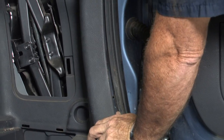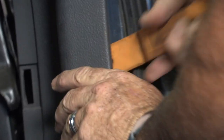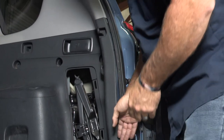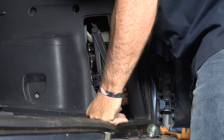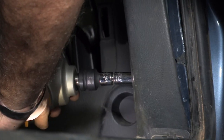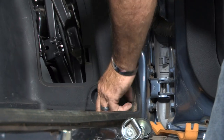There are going to be body plugs up and down here that we're going to find and pull out — and it'll unclip. As we're prying apart, I've got all the body plugs, but I just realized I missed one attachment point here — a cargo anchor with a 10 millimeter bolt holding it in. We'll take our impact tool and unscrew it there. Set it aside. Now the body should just come right out.